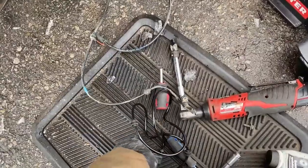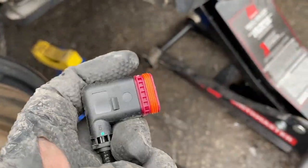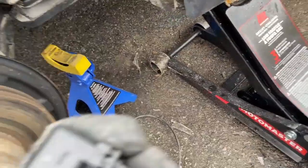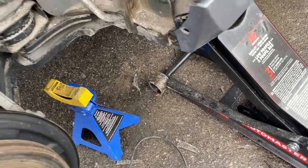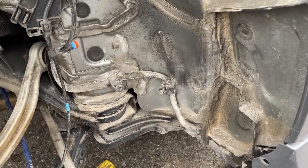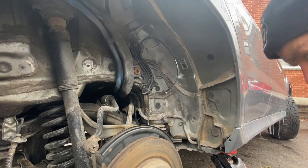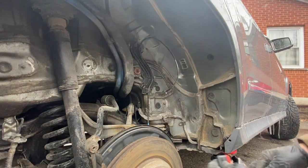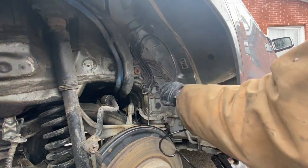New sensor and old sensor. Before I put these together, along this rubber seal I'm going to put a little synthetic dielectric grease on both of them — the old connector end and the new one — and then clip them together. They just push together at the neck. Going to put a little grease around there. I'll put you on a tripod to watch this since there's no rain right now.